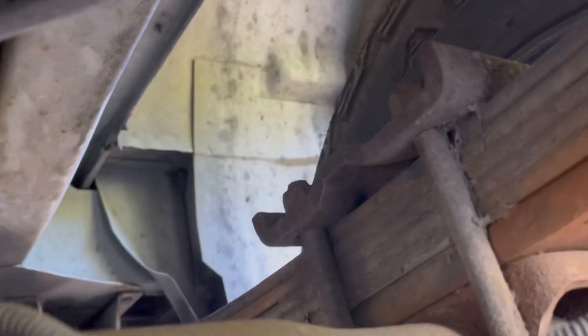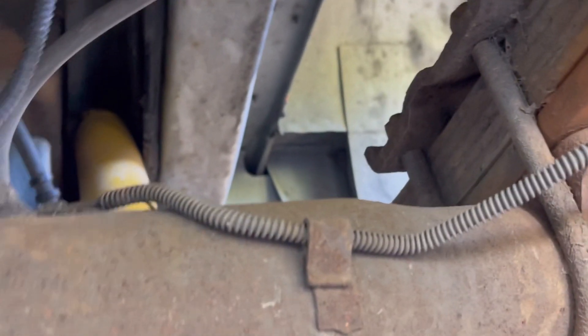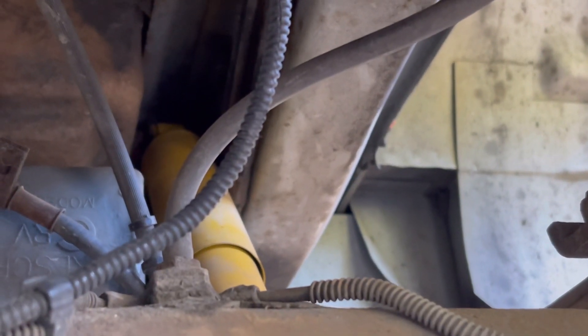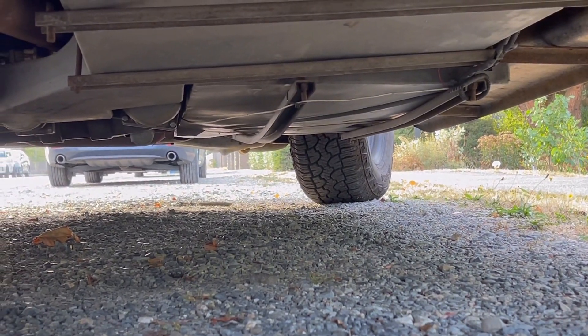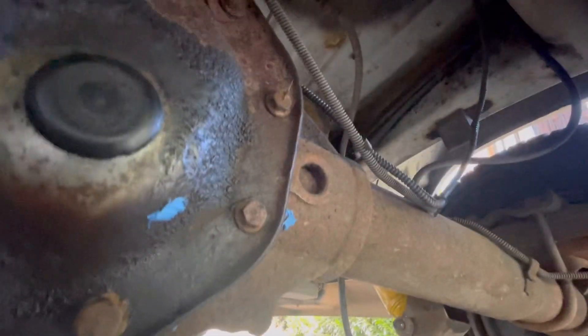Here is the finished installed shock. On these Roadtrek vans specifically, it is quite a booger — this is my third shock and each one has had its own challenges. Up between the black water tank and the frame, there's just barely enough room for the bolt and your fingers. I'm using a three-quarter inch combo wrench — that's all the space there is. I didn't do a video on the front shocks but you can see the yellow shocks installed — those took about 12 hours between the two of them, between cutting off the rusty old hardware and just fighting with it. The RTV is pretty dry now — it's been a day.